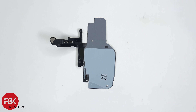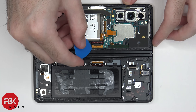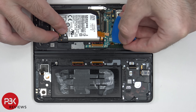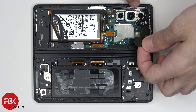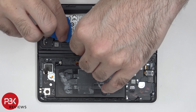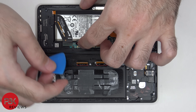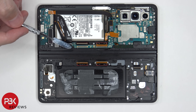Now the battery cable can be disconnected, and once that's disconnected we can disconnect the rest of the cables. On this plastic assembly there's a flex cable and the NFC antenna. We're going to proceed to remove this cover. At this point there are two more flex cables which need to be disconnected. The bottom plastic cover can also be removed. This flex cable connects the sub board to the main board, as well as this flex cable here.